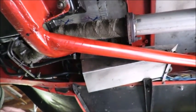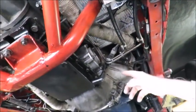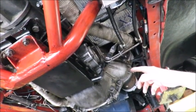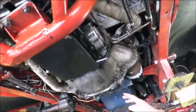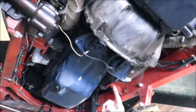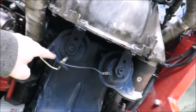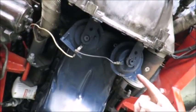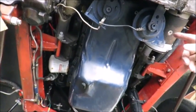Like I said, this is a C4 transmission. It has a stall in it, it's an 1800 stall transmission. 12-volt system all the way through the whole car. Actual Ford horns, honk honk. And what else we got in here? These are Delco Remy. And are they Delco Remy? Yeah, I'll take that. You got it confused with one of your other cars. I sure did, didn't I? I've got too many parts going all the way around here.